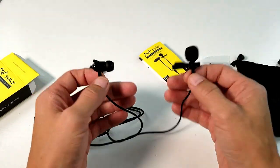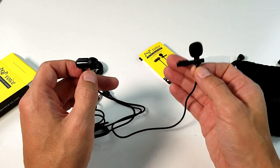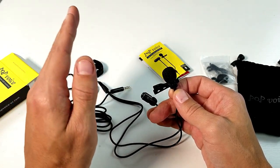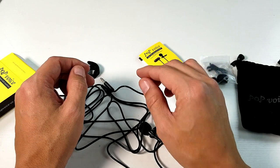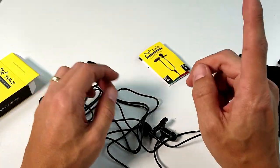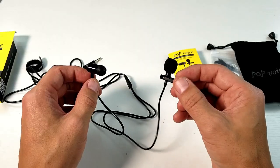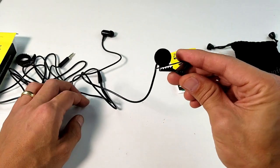If you're using your smartphone just to record videos like I am right now, when you plug this in and you're talking, you're not going to be able to hear yourself. The point of having this earphone is so that when you pop your lav mic in and want to test the sound, you can make sure there's no buzzing in the background. Sometimes I get a buzzing sound and have to reboot my phone. With a standard lav mic, I have to say testing one two, then unplug it and press play or put in another pair of headphones to check the audio. However, with this, you don't ever have to take it out. You can simply press record, say testing one two, stop it, play it right back, and you'll be able to hear it directly from the earphone. And if you're recording video and don't want the earphone showing, just drop it down your shirt and keep the regular lav mic on there.